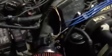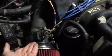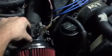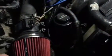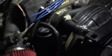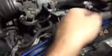I'm using the stock 3.0 radiator, 3.0 fan shroud, and I think even a 3.0 fan. I did have an air box on this — it fits and looks factory — but this is where getting all your parts from the same vehicle matters. This engine came with a 3.0-style MAF where the whole unit is the sensor, whereas a '99-style MAF is just a drop-in sensor. This full MAF assembly doesn't fit the '99 and up air box, so I haven't been able to find the right air box yet and I'm stuck with a janky setup for now.